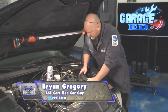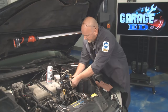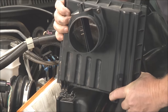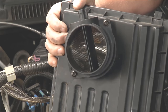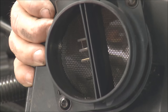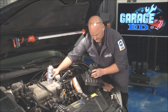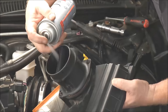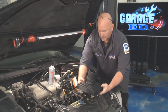Clean is absolutely critical, and you're going to see why. This is pretty easy access, so I'm going to pull the connector — I've already got the clamp loose. Take care of that connector; it's brittle and there's a lot of heat up here. Slide this back and roll it right off so you can get a good look at those blades. See those little heating elements? Those are typically platinum or nickel, and you've got to take care of them — don't touch them, you'll damage them. You must clean this with the proper chemical. You can't use brake cleaner, gum out, or carburetor cleaner — use mass airflow sensor cleaner. Spray it pretty liberally at full blast; you want that pressure to clean those elements. Let that sit for a second while we inspect the rest of the system.